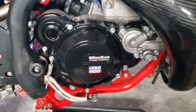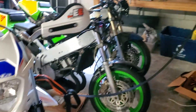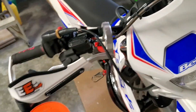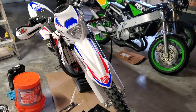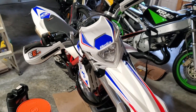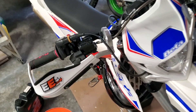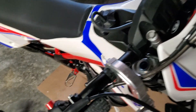Another trick I do sometimes — if you can see this, I've tied the handlebar to that shelf there, and what I'm going to do is just tip the bike over gently like this. One hand here, I put it in gear so it doesn't roll away on me, and you can see it's pretty tipped over. You can do it with a strap or lean it on a bucket, whichever. I'm doing the main work while it's upright on the kickstand, then I'll tip it over to drain it, and hopefully it'll miss the frame a little bit more, drain a little faster.